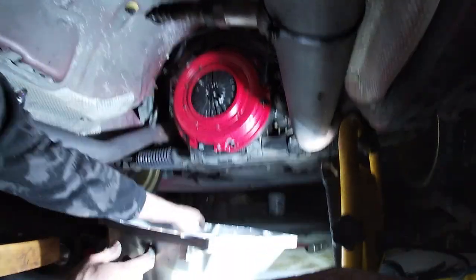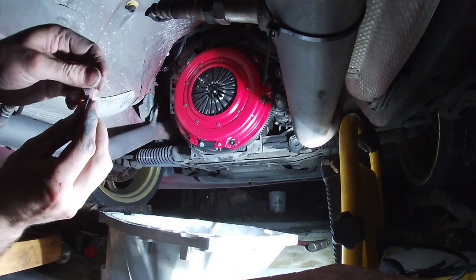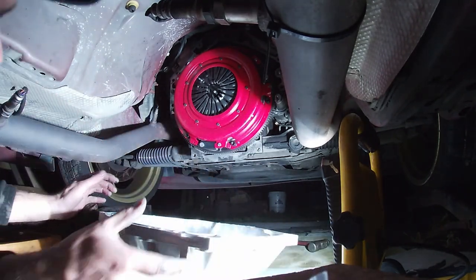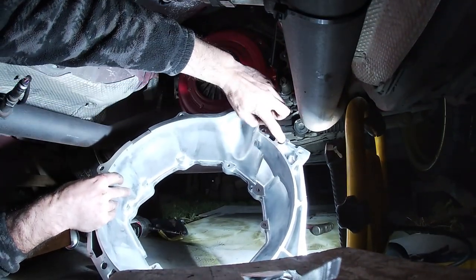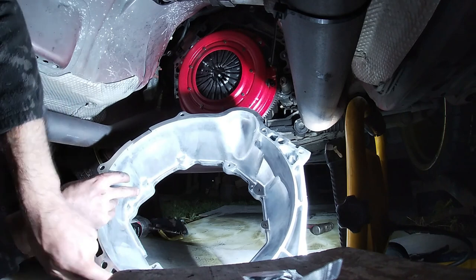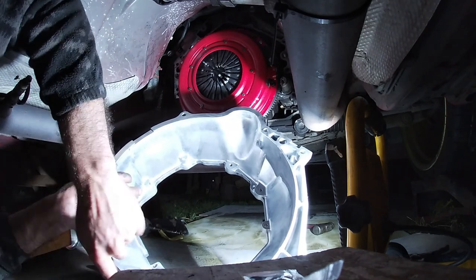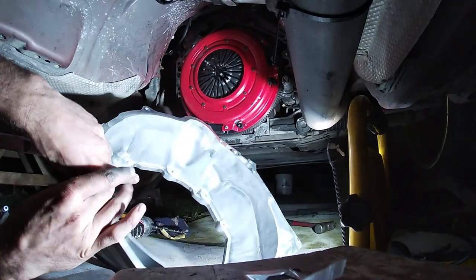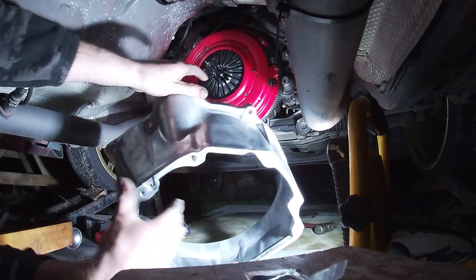These dowels are horribly tight, so I've given them a wee sand, and inside the dowel holes on the gearbox I'm actually going to put a wee bit of grease. I might just alleviate it so I can get it back off, I hope without prying with a screwdriver this time. Be nice. Tolerance is a bit nicer with a bit of grease. Well, anyway, most importantly, I hope the starter motor snout clears the bell housing.